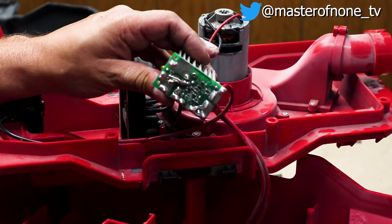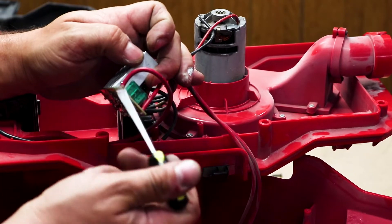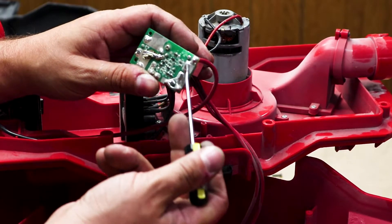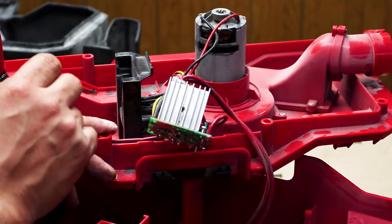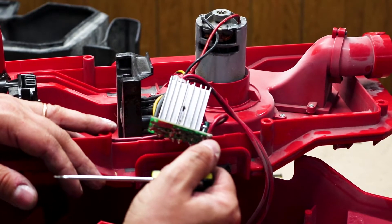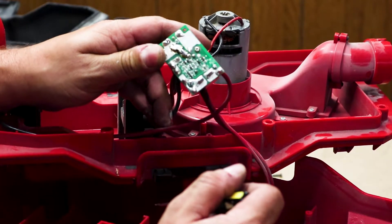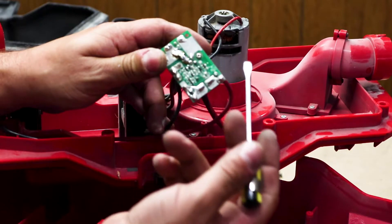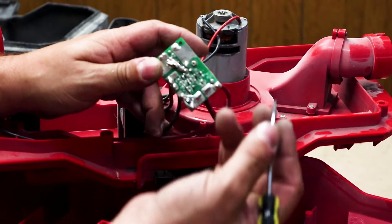So if you're having a no-power problem with your Milwaukee, this might be the issue. The second thing you might want to check is this fuse here — that's a 30 amp fuse soldered onto the PCB board. If that's not it, I would definitely check all the connections and make sure nothing is burned. Then I would check the brushes on the motor — that might be the problem. There are also other components here that you need to make sure none of them are blown. If one is, most likely you won't be able to find a replacement to fix it, unless you work with this stuff all the time.